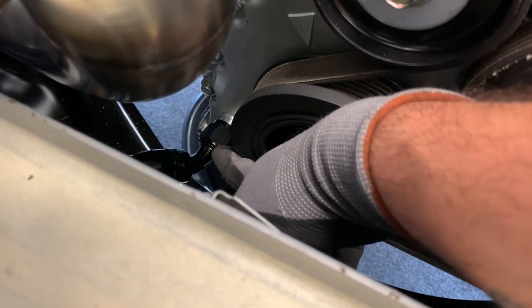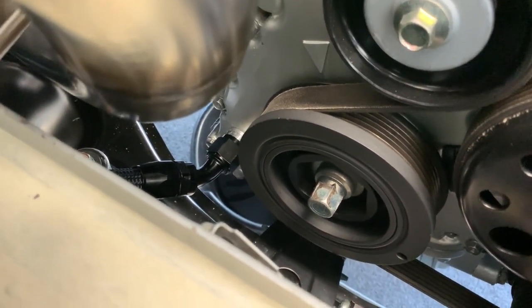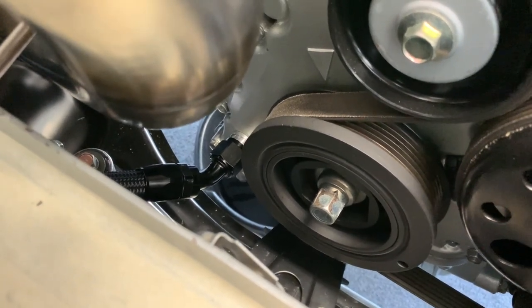One thing I highly recommend: run the dash-10 drain at the front of the timing chain cover. It has its own little passageway, no obstruction from oil level sloshing around — especially if you're road racing and taking turns. It sits up high above the oil pan. I do not recommend tapping the girdle and definitely not the oil pan. You'll hear people say they ran it in the pan and they're fine, but your drain line is right near the drain plug. Journal bearings are so sensitive — Precision specifically. Run it at the timing chain cover. If you can't, go as high as you can in the pan, and for the love of god do not use the drain plug.